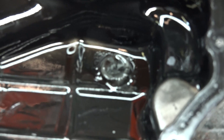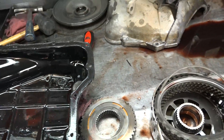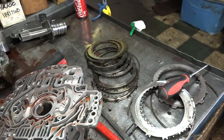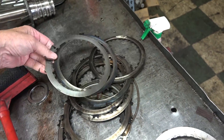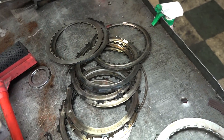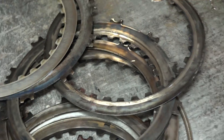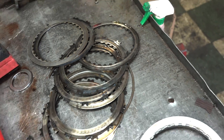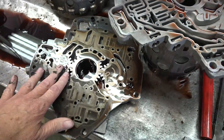A little blurry there, and where that metal was coming from was these clutches. This clutch — they alternate steel and friction plates — and they're down to the metal, metal to metal, no lining. And that ground-up metal has gone through the oil pump and chewed up the oil pump.